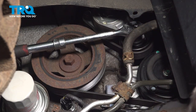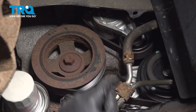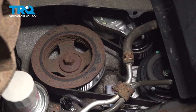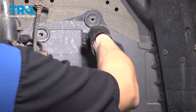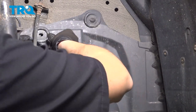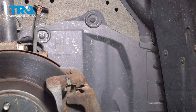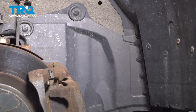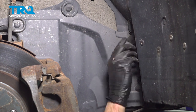It's perfect — you definitely want to make sure you double-check that, because if it's not, you're going to have some serious issues once you turn on the engine. Remove your tool and let's get the shield back on. Let's get the shield lined up. I have the two push clips that I can reuse — they did not break here at the top. A lot of times these do break, so make sure you have some extra ones on hand.